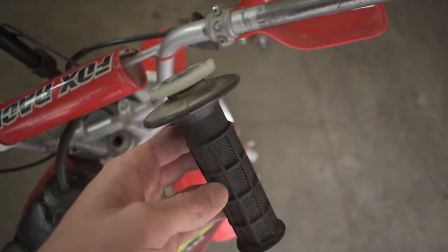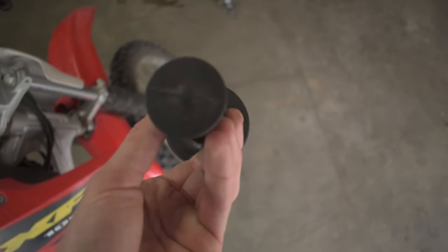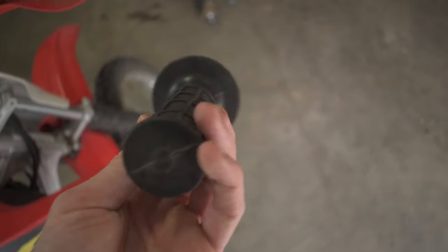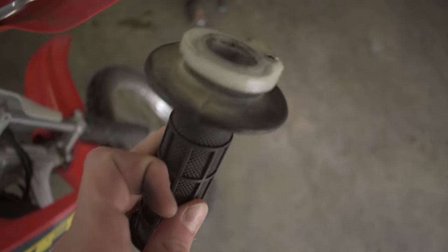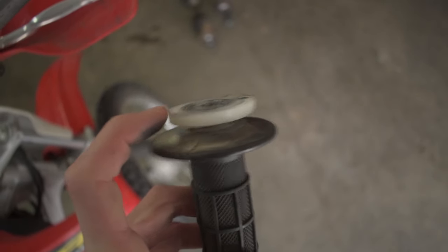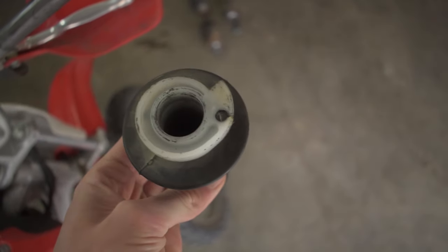If you're thinking of changing your grips, this is the perfect time to do that. If you have wraparound hand guards, the end of your grip has a hole, and it's possible that dirt has been shoved down in there and is getting in between the rubber layer of your grip and the plastic throttle tube, so you have it grinding in between the grip and the throttle tube.